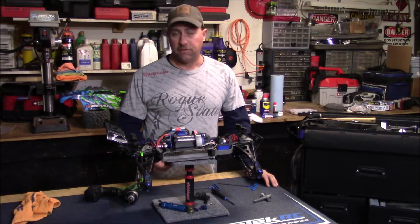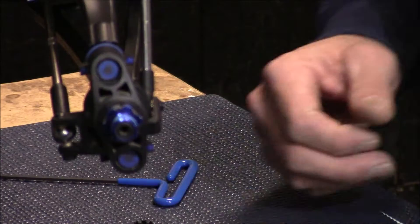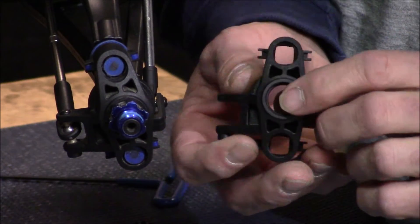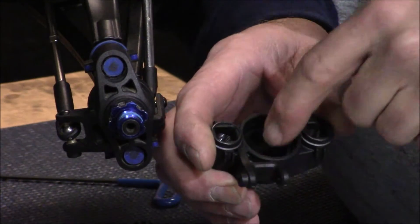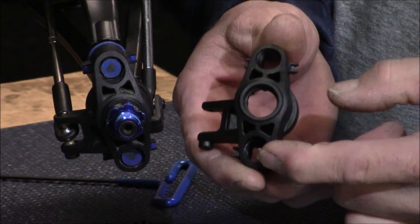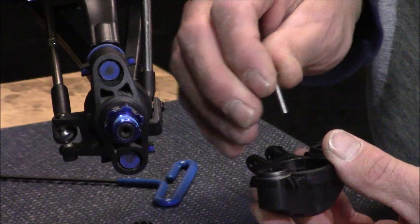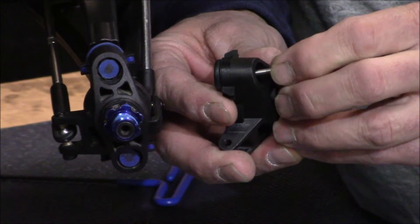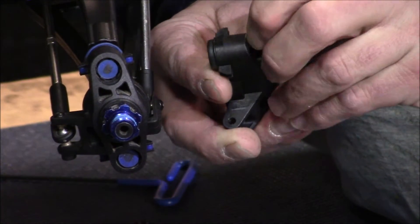Let me show you how to adjust your pivot ball inside of the axle carrier housing. Here's your axle carrier and your wheel hub. I've got another axle carrier housing without parts in it to explain how the pivot ball works. Basically, you've got your front bearing and your rear bearing and the axle goes through the center out to your wheel. These other two holes are for your pivot balls — you drop your pivot ball into these holes and they come out the other side, which is what attaches to your control arm. This gives your control arm a full range of movement on this pivot ball.